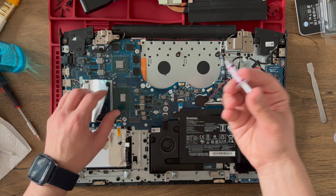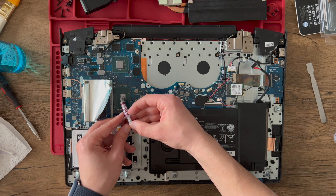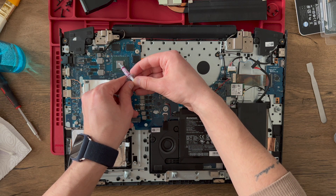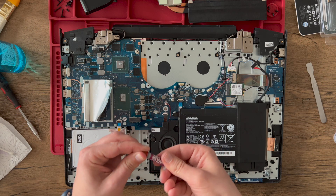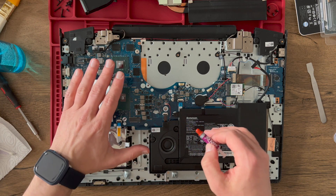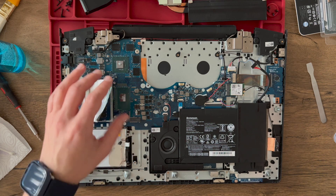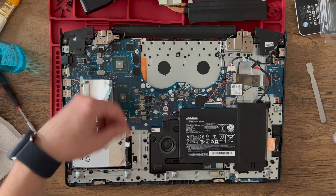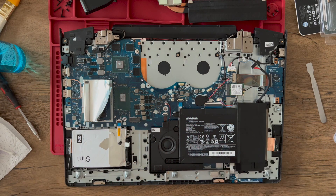You don't need much — just a pea size. There are people that like to spread the thermal paste across the entire CPU and GPU, but I like to let gravity do its own thing and just place the heatsink on top. This way we ensure there will be no air bubbles and there's going to be good contact between the CPU, thermal paste, and heatsink. If you spread it and do a lazy job, you might introduce air pockets, and this is going to cause heating problems.